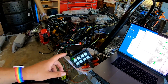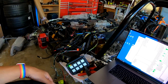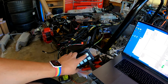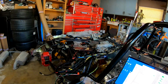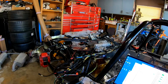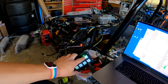And now we come up to one of the first sort of party tricks. Doesn't seem like much, but it's kind of a pain in the ass to configure, or to get right anyway. So the last button on the top row, button number 4, is for my wipers. So if I push once, the wipers are in intermittent mode. So it cycles once, parks, and then it waits for 3 seconds, lather, rinse, and repeat. It also lights up the first light.